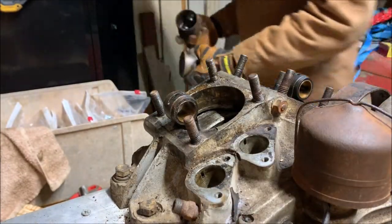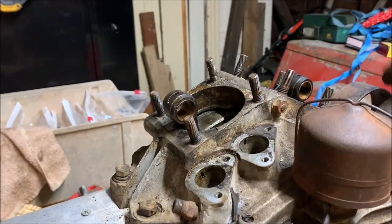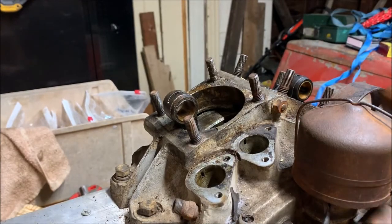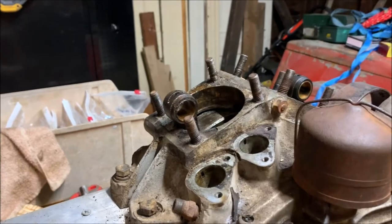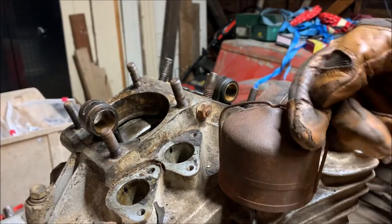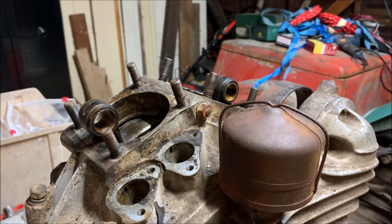So, there we go. Our two pistons are removed. Next, I believe we'll want to take off the distributor, or I should say the points section. Distributor would be a word for it. I don't know exactly what Harley calls it, but it'll be this thing. This whole section actually goes down into the cam chest here on this gear run, so we're removing all that. Now what we'll do next.